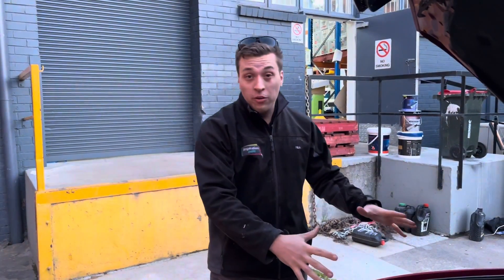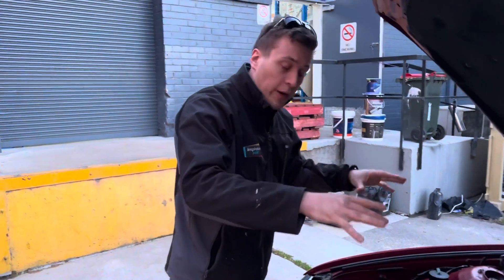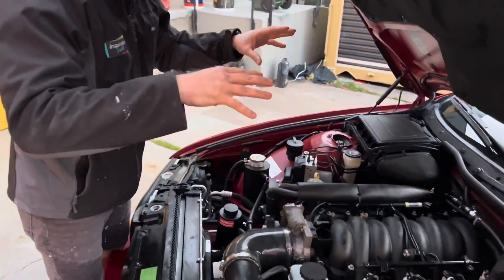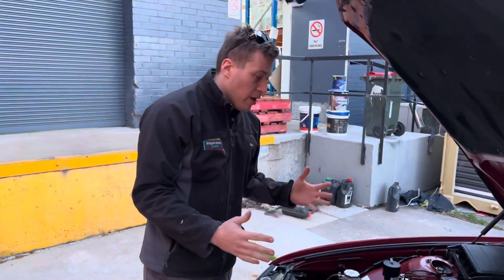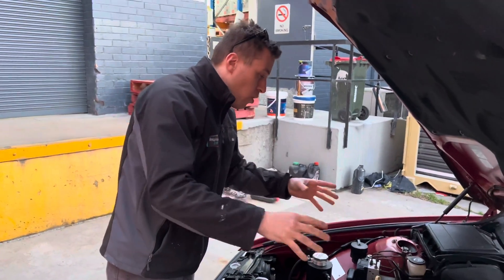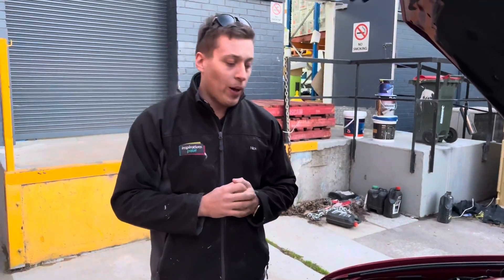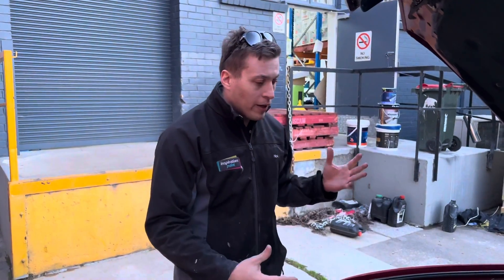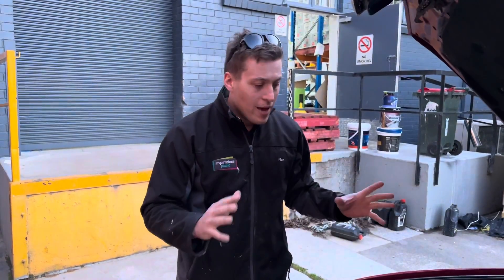The BMW 5 Series — I got really lucky. The engineer just wanted a correct placement of the engine. This car came out with a V8, which was a massive help, so the engine placement worked well with all the crash sensors. All the fabrication stuff was done by Brinton Customs up in New South Wales, so everything was of high quality — it met all the proper thicknesses and proper welds.